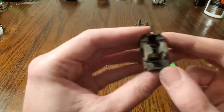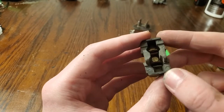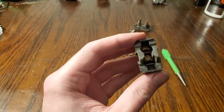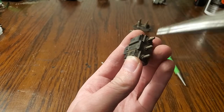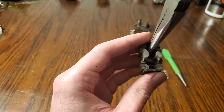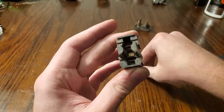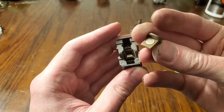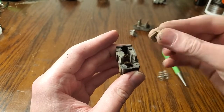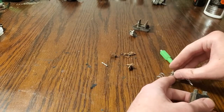So how the switch works is, lighting's a little bit bad in here right now, you have two pairs of contacts here, of course. So this middle terminal is your common terminal, and then you have your terminals for up and down or vice versa. The switch itself is symmetrical. So you have a pair of contacts here and a pair of contacts down here. These pieces here just have a piece of metal in them, and then when you push the window switch one way or the other, that just pushes these down in. I'll get a spring here so I don't get one stuck.